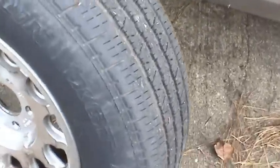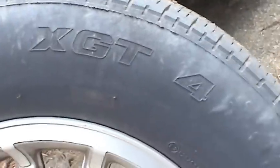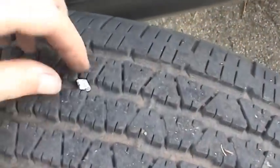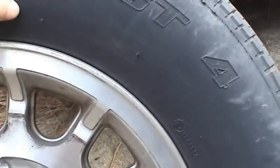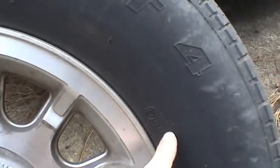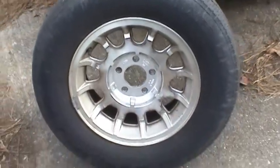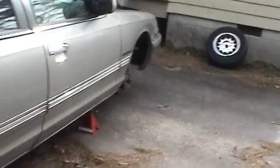And the original 17-year-old Michelin XGT4 tires also have a lot of life left on them. I've never driven on 17-year-old tires but they're not that bad — they're not cracked or anything. Usually what messes tires up due to aging is sunlight drying out the rubber, causing deep cracks. These tires are old but in good shape, and I still want to rotate them because I don't think that's ever been done.